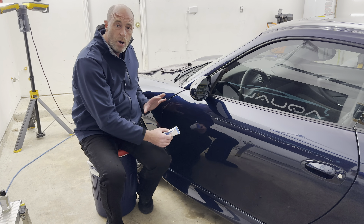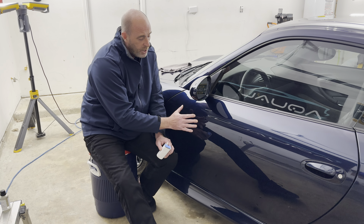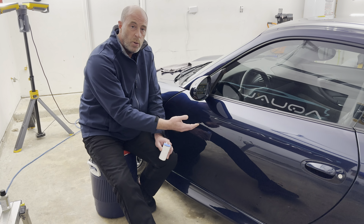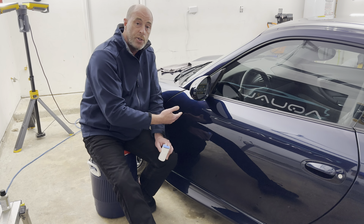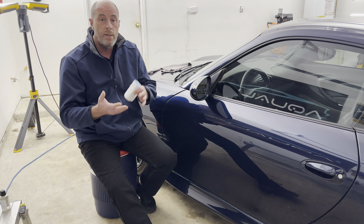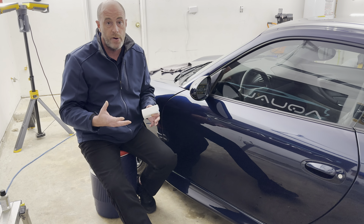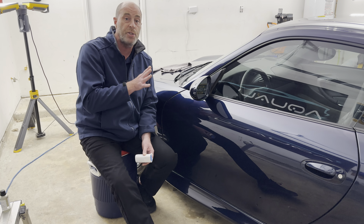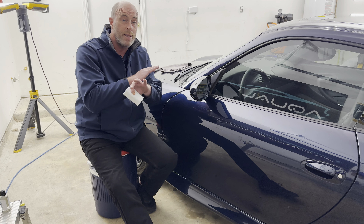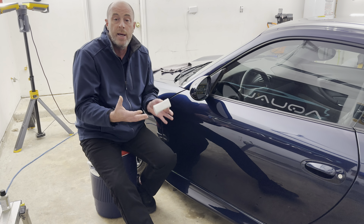When we're done applying that coating in our two-by-two area, we're going to watch the coating flash — it can give off a rainbow hue or it can microbead. What's actually happening during that flash moment? Initially, the bonding agent bonds to the paint first. During that flash period, what we call resin load transfer occurs. These are the resins required for the ceramic coating to make it incredibly hydrophobic — they give us the water contact angle, the self-cleaning properties, the slide contact angle, and basically the coating evacuates water as fast as it can. This is the beautiful part of coatings.